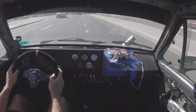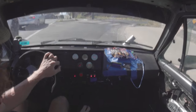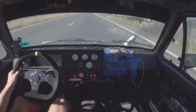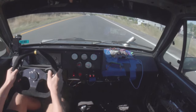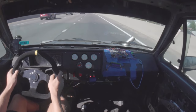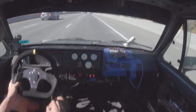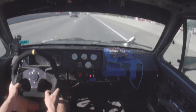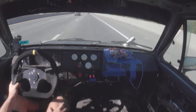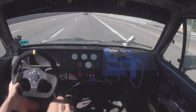We're back on our test drive grind. We just advanced timing 0.003 inches from where it was. This is second gear — it feels a little better. Fourth gear — feels pretty good. It's hard to judge how fast it really is; we're at 55, I guess it's pretty good.